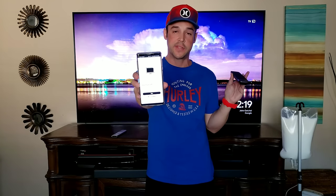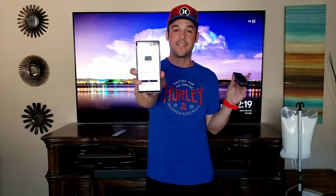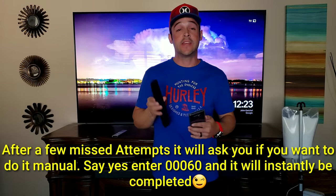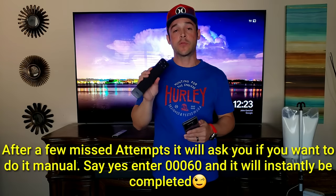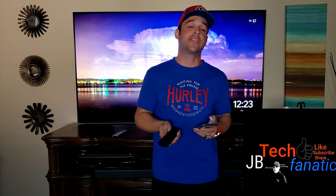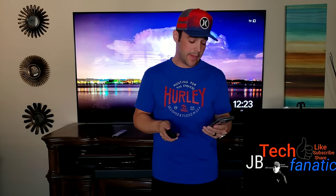Now, you're going to hit turn off now. Did it work? Yes or no? As you can see, it did not work. No, try again. So I hit no, try again. And we're going to continue to do this until it finds it. For my Samsung TV, it ended up not picking it up, so I did it manually. So you know, the code is 00060 for Samsung. If you have a different TV and you run into this issue, you could reach out to me and I'll give you the code.